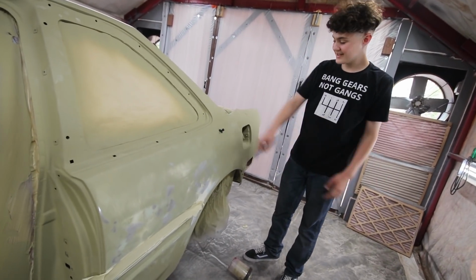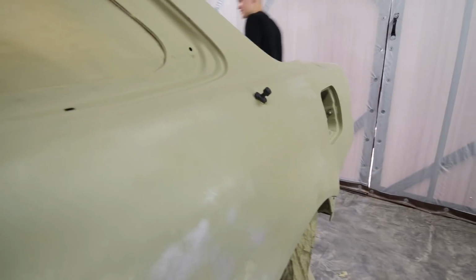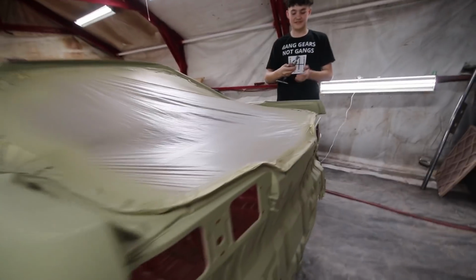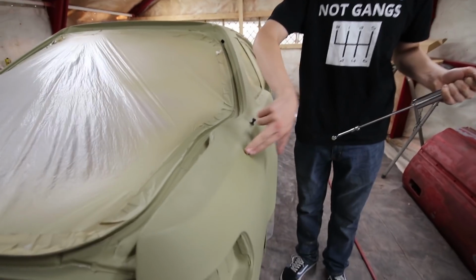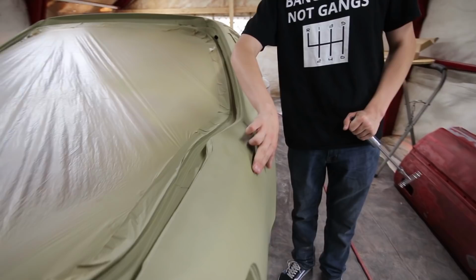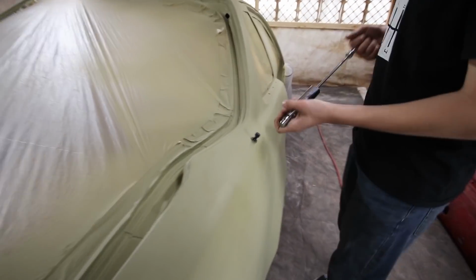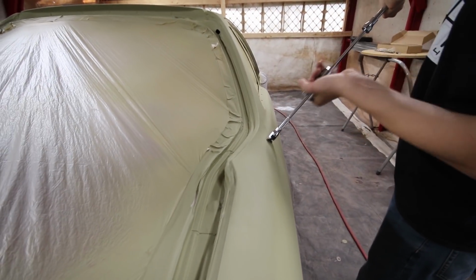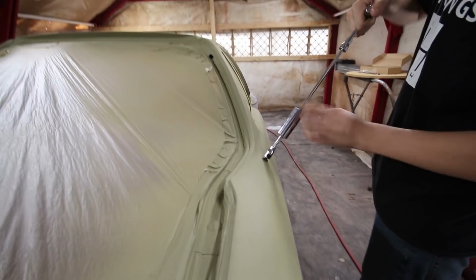So I have a dent here, then I have a dent right there. Is that to pull the dents? How does that work? I'll show you right here. Is there a tool for that? Yeah, it's a slide hammer. It's not that hard, it's just tedious because this was really far in before. Then there's the dash across there. I've already got this one almost all pulled out. It just has some hot glue on there. So it's pretty simple. You just gotta slowly pull it out.